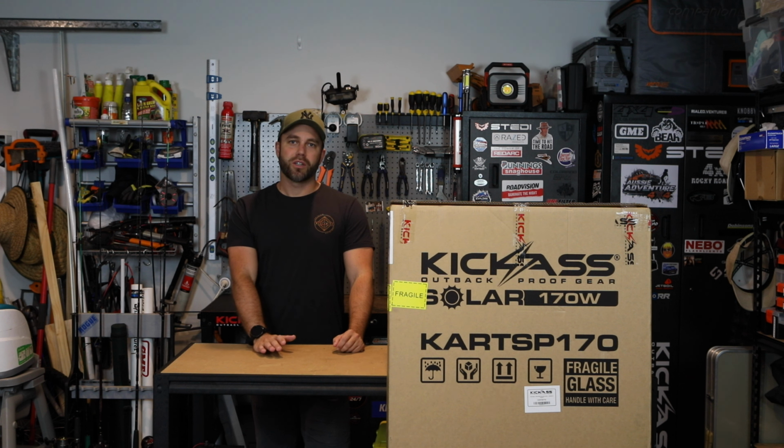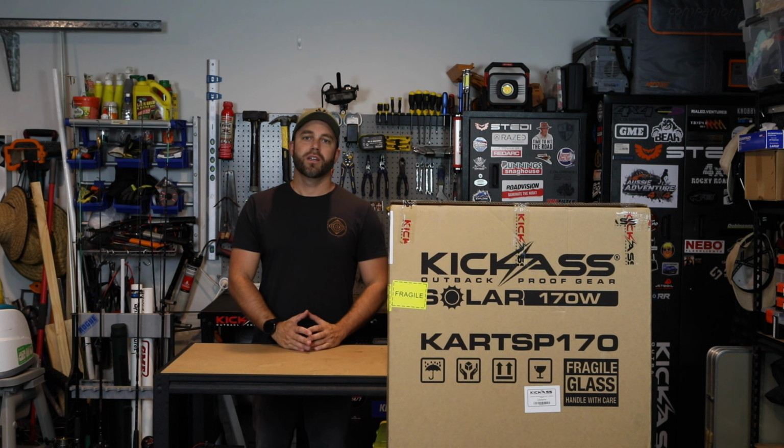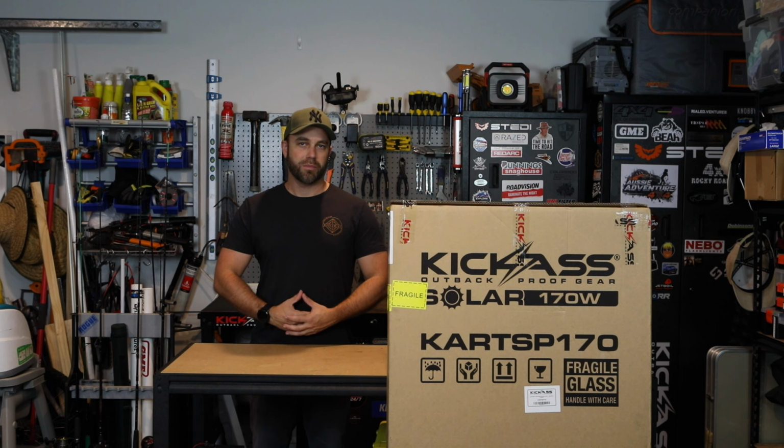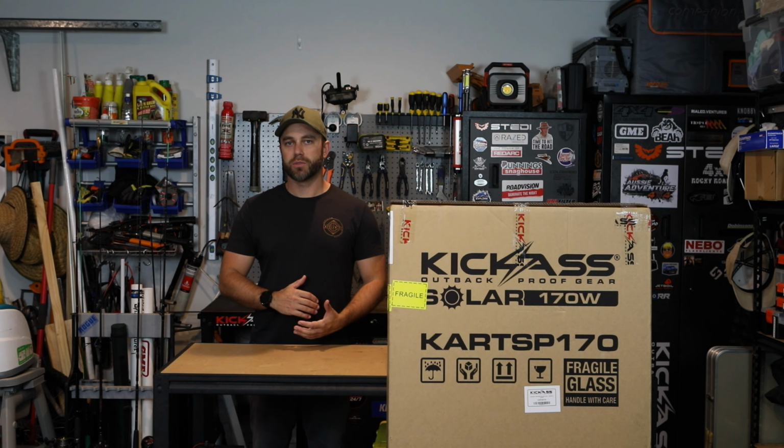So currently I'm working on a mate's 12 volt system in his 2017 Mazda BT50. It's got a canopy on the back, currently running a 100 amp AGM battery. We're going to swap that up for a lithium later on. It's charged by a 25 amp RedArc BCDC charger just through the alternator at the moment.